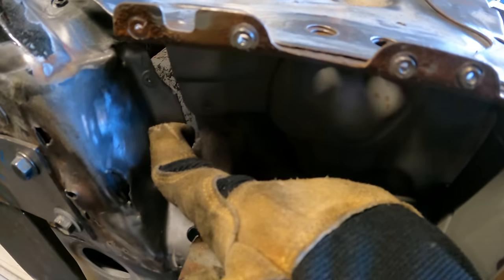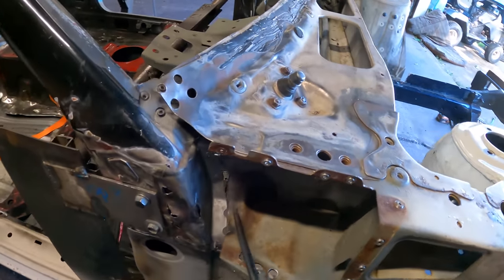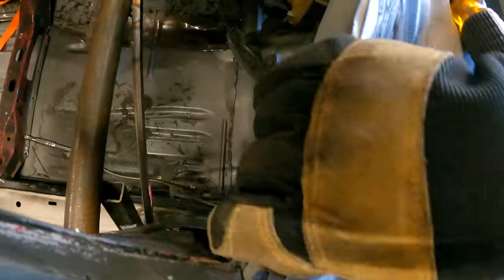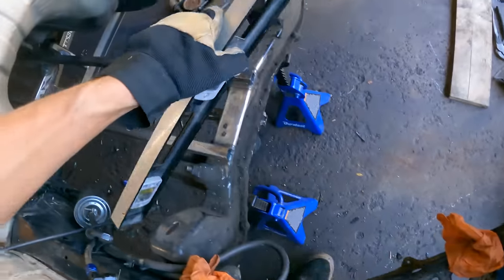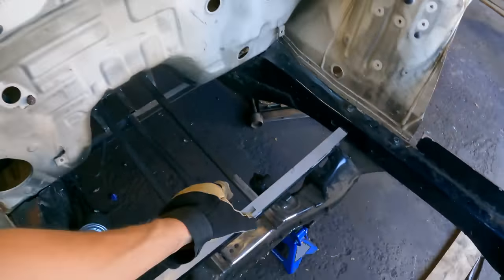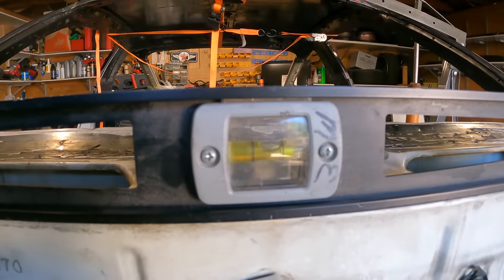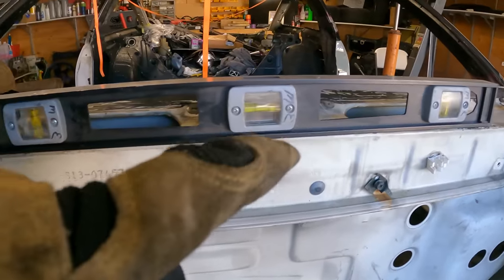The firewall needs to go on top of the A-pillar for this section, so I'll use two hands and pry it over. I've got it on top of this lip but still need to push it down a bit, and I notice I need to scoot the whole firewall over. I grabbed the level from midpoint to midpoint on top of the subframe — it's leveled out, looking pretty good. Comparing that to the firewall, it looks like we're a little high on the right side, so that side needs to come down.